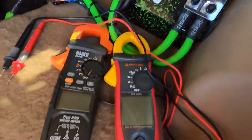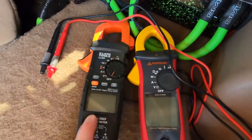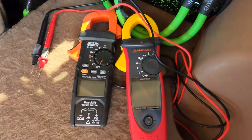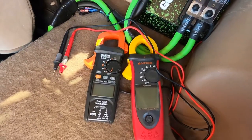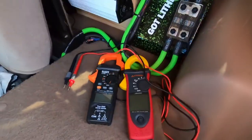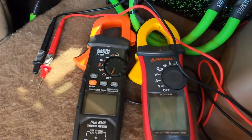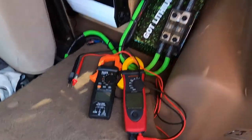I hope this helps some people out today and gives you an idea of actual in-vehicle power. All you need is an AC clamp and a multimeter that reads voltage, and you can see the actual power you're getting. Don't just go off of the dyno ratings because they're fixed variables — they don't include impedance rise or anything else, so those are always way high. Get yourself an AC clamp and a voltmeter and see what you're actually getting.